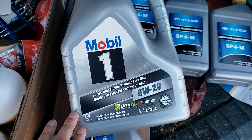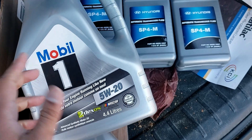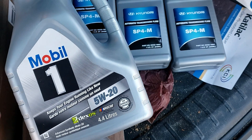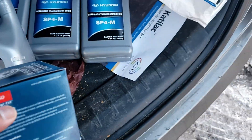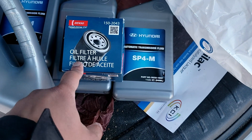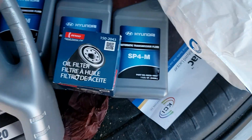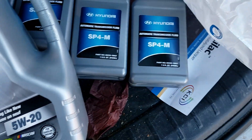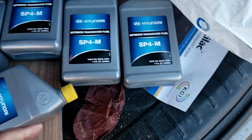While doing all of that, I'll also get an oil change done. The vehicle takes 5W-30, but I had 5W-20 on hand and it's super cold in Canada, so I decided to go with the 5W-20. For the oil filter, I'm going with the Denso 150-2043. The reason I chose Denso is that Rock Auto had a sale and I bought about 15 filters for four dollars each — can't go wrong with that.